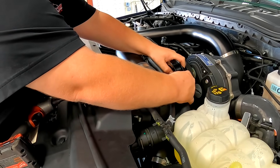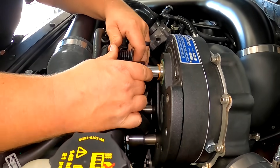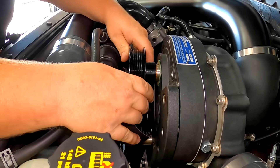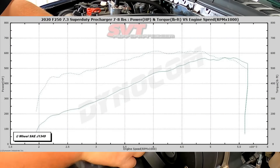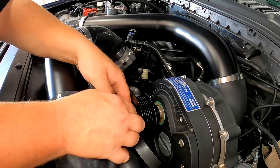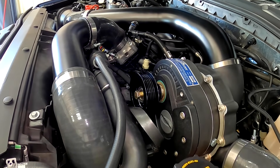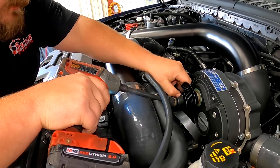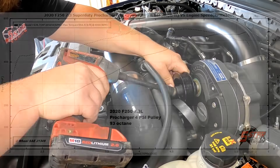We happened to have a nice range of pulley sizes on hand, so it seemed like a good idea to start trying them out. We swapped out the 3.5-inch pulley to a 3-inch one, which takes the boost level from 8 to 12 psi. The results really weren't great — we should have seen a gain of 40 to 50 horsepower, but the blower was too far out of its efficiency range to properly provide the required airflow. After that discovery, we decided to bolt on a 4-inch pulley, which produced between 4 and 5 psi, and it made exactly 40 horsepower less than the 8 psi setup — exactly what we were expecting.